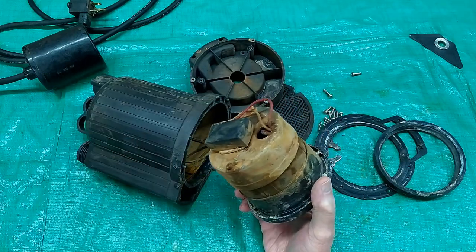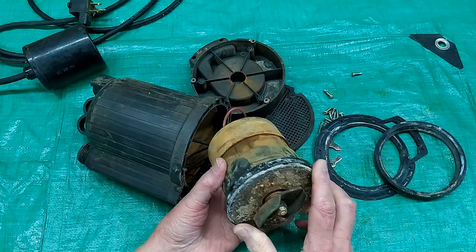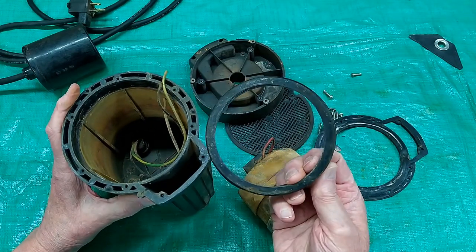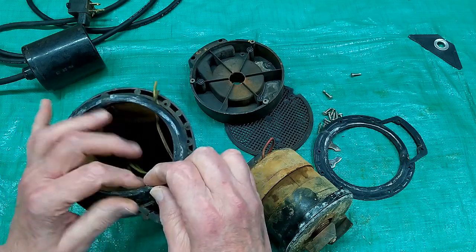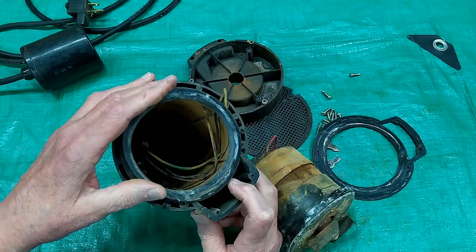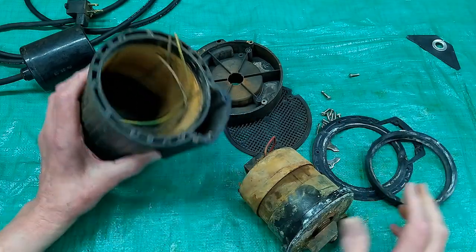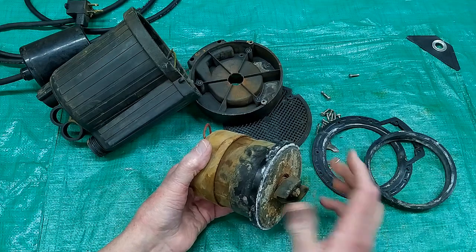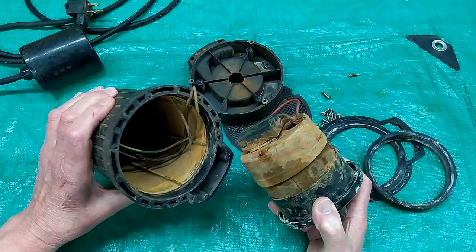This was full of water. Why it did not blow a circuit breaker, I don't know. When I brought it into the shop I didn't know it was full of water — I plugged it in and it blew the GFI, but it still turns. That rubber gasket had one little bad spot that looked like it was lifted up. There are really only two places for this to leak: it either leaked around this gasket or there's a shaft seal that keeps water from going into the motor housing, and one of those two failed.